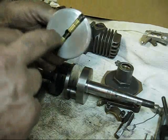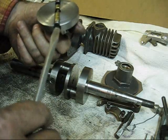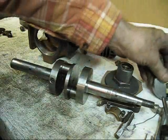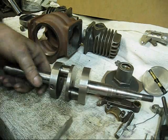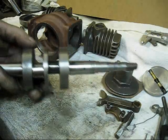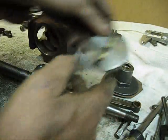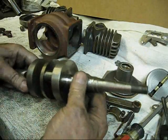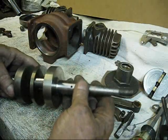This spring right here is dependent on how far down you adjust this screw here, and you don't make this adjustment until the engine is running. I put that right there and it's pretty snug - it won't work loose. This one up here is down in there about an eighth of an inch, same as this one right here. I'm not sure if it even matters which direction that goes in - I have taken them apart and found them both ways.